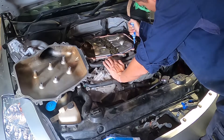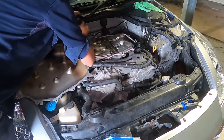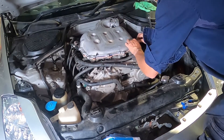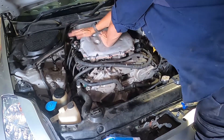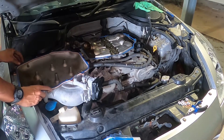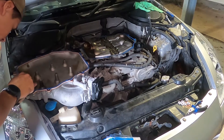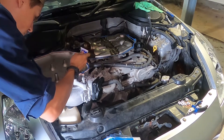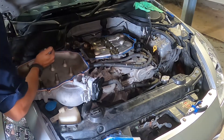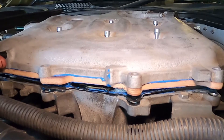Then we're going to put some more gasket maker on the top side of the plenum spacer and make our way around. I did a little test fit with the plenum just to see what sort of contact surface I was working with — checking if the gasket maker was squeezing all the way across the surface evenly — and then went around and corrected any spots that didn't have enough on them. After this I put a little bit on those tall studs inside the plenum that add structural support, and put some gasket maker around those and the little spacer rings as well.